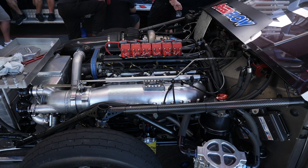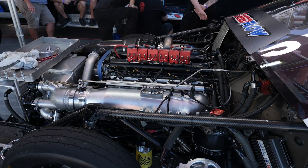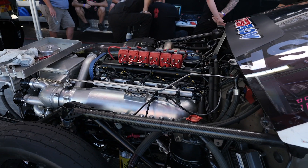One of the advantages of controlling boost this way is it gives very stable control of boost on the two-step launch control. This is essential with these cars that run an adjustable drag racing style clutch, because the car needs to leave the line with precisely the same RPM and the same boost pressure every time if the clutch is going to work consistently on each hit. With a conventional exhaust wastegate, we tend to see the boost pressure climb up and down a little bit, moving around the set point and not giving the consistency that's really required.